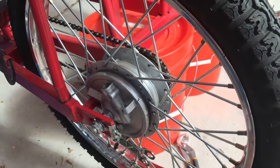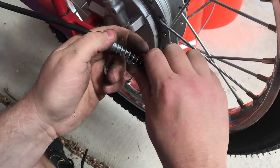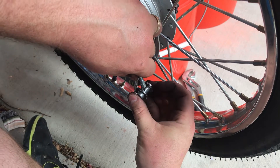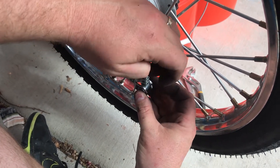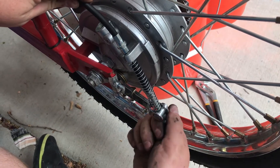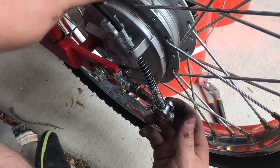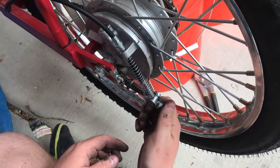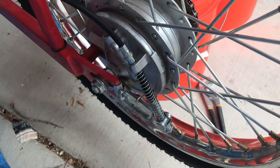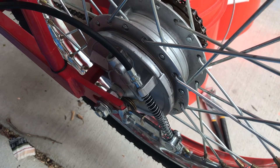To put the brake cable back in, feed it on the outside here. Put the spring in, put the bolt through here and through the loop, and hand tighten it. I'll give it a couple more turns but we'll have to see — if I apply too much it starts wanting to push the brake, so we don't want to move the brake by over-tightening. Now pulling the lever — that should move the arm — perfect action, fantastic.